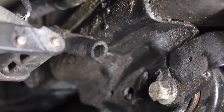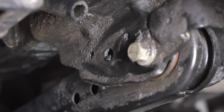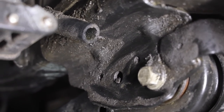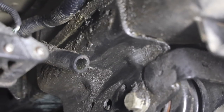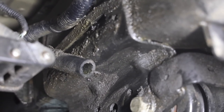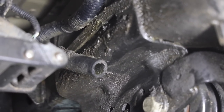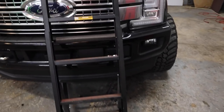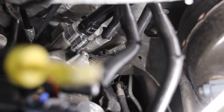You can see the old buildup of all the oil soot that was gathering back here. I wiped it off a little bit so it wasn't sopping wet, because now I'm going to idle the truck and see if any oil actually comes out through that hose. After seeing that whole baffle thing I don't think any oil is going to make it past there, especially since it has to go through that and the venturi fitting and then come out of the hose. Let it idle — we got no leaks up top, everything sealed up there, looking really clean.